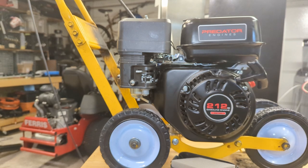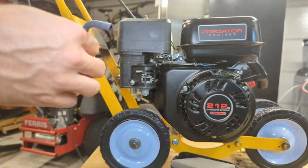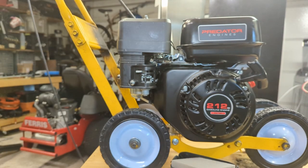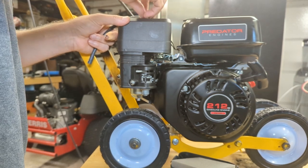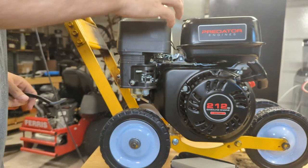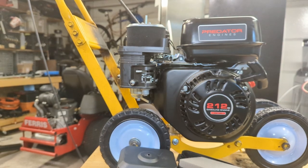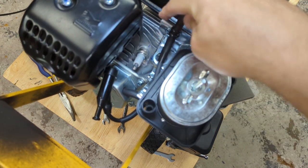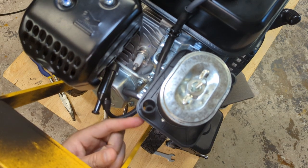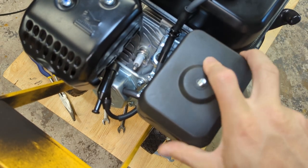You've got to check it on a pretty regular basis and replace it. Now let's put this hose back in. I might just drill a hole in this thing — call it a day, because it's just for emissions. When I say emissions, I'm using that term loosely — it's really a fuel tank vent, so we do kind of need it, and it'll probably leak gas if we just leave it open. Actually, no hole required — I just ran this hose from up here, down, around, under this little bracket and clamp, and up through this hole here. I think it's probably going to stay. If not, I'll just drill a hole somewhere.